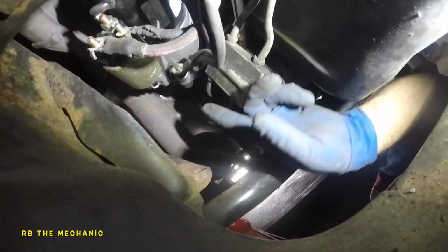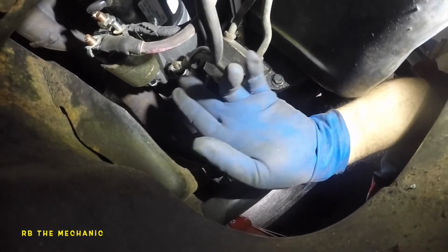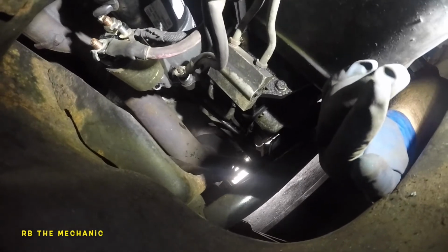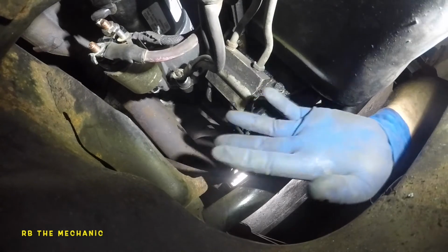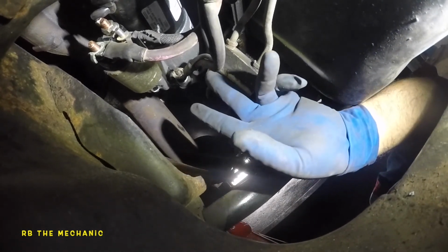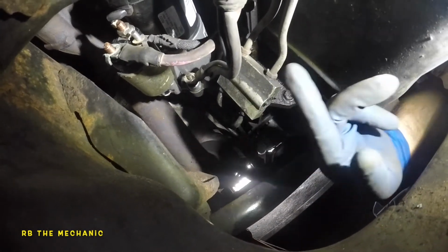But first, what I'm gonna do is I'm gonna torque everything, then I'm gonna put this ground cable in, put the nut on, tighten everything up, crank it, start it, check it, and you get the point, okay? Check the starter before you go crazy with the third bolt, because it's not gonna matter, because two can hold pretty good. And then do make sure you put the third one in. Bye bye, and we'll see you upstairs.